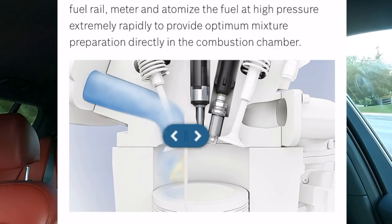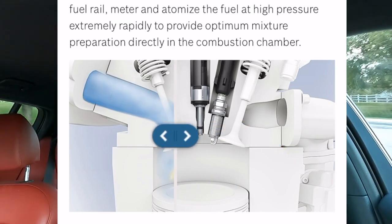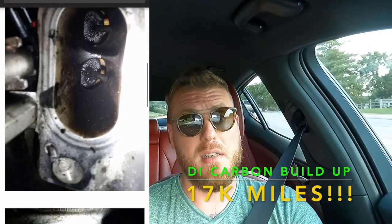The one I went with was the Mishimoto Direct Fit. I've seen enough videos where every thousand miles there's like 10 milliliters of oil contamination. The reason you want an oil catch can, especially on a direct injection motor, is because fuel is being sprayed directly into the cylinder. This type of engine is great for power and tuning capabilities, but the drawback is excessive carbon buildup. I've seen photos of Kia Stingers with 20,000 to 30,000 miles without a catch can — these weren't even modded — and the carbon buildup was insane. The only way to really get that off is to walnut blast it.